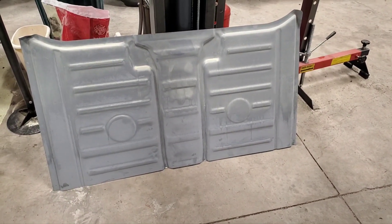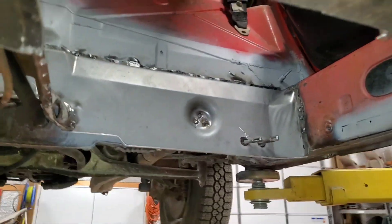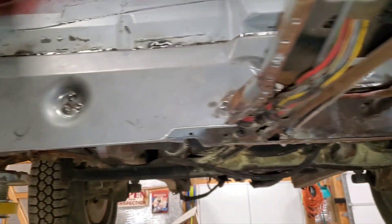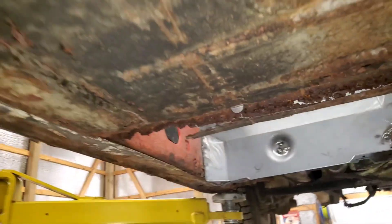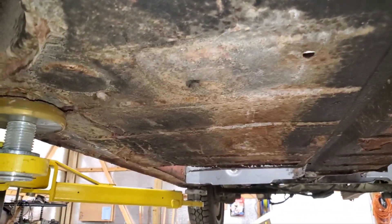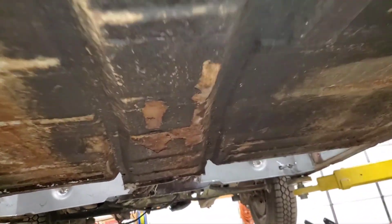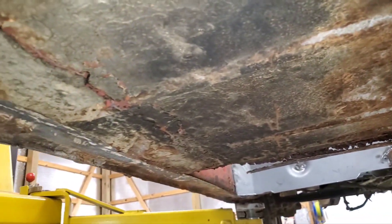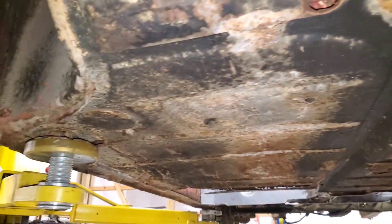Now it's time to go back to the floor pan. The lower inner firewall work is all done, so now I can start to look at how the rear floor pan is going to join up. The front pans on this car aren't too bad, just a couple of corrosion spots. I need to scrape what little cosmoline is underneath here - I've seen 914s with not only cosmoline but also undercoating, which gets to be a real troublesome. So the first thing I'm going to do is get out the vibrating scraper and scrape what's left and clean it all up.